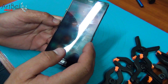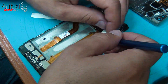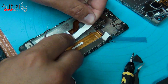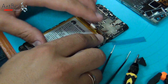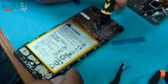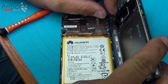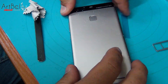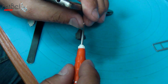Turn off the phone and assemble it. You need to glue the new or old battery — stick a new double-sided tape so that it is easier to remove the battery during the next disassembly. Glue the battery and turn on its connector. Put back the two covers on the motherboard and screw all the screws back. Connect the fingerprint connector, make sure you have not forgotten anything, close the cover, press it around all edges so that all edges fall into place, and screw the two screws from the bottom of the case.